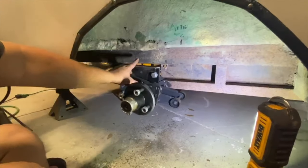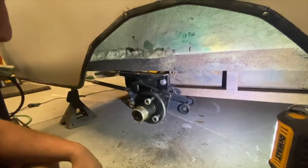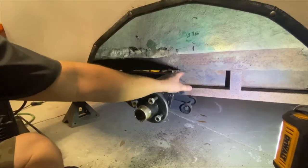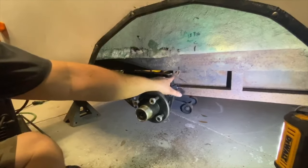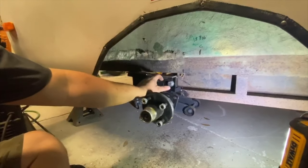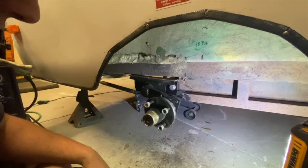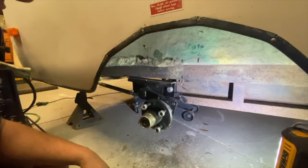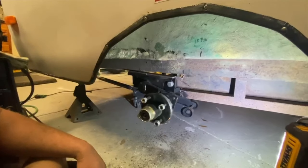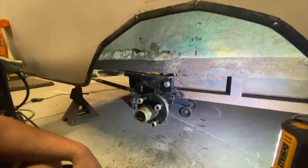Here's what we've run into. This is the plate that's supposed to be welded on - there are two bolts for the axle. This bolt is too far forward to be able to slide the axle past our mark right here. And so unfortunately I think that means we're going to have to burn the plate to the axle and the plate to the camper on this older style. On the newer ones it may be a possibility, but typically we're working on a little bit older campers here. So we're going to take that bolt out and get this thing right where it needs to be.